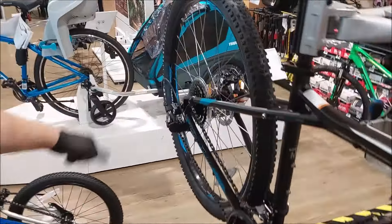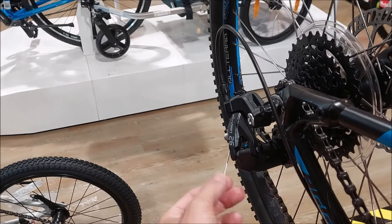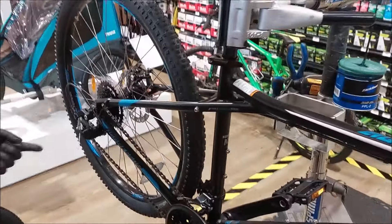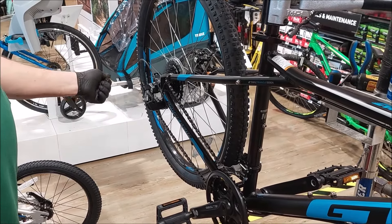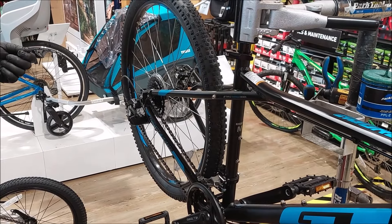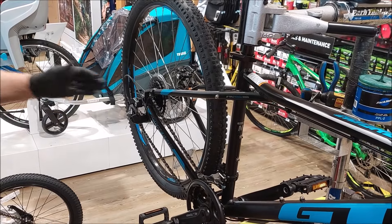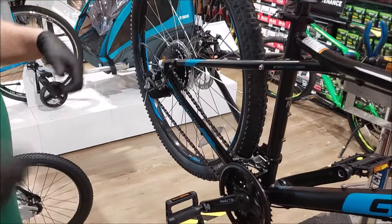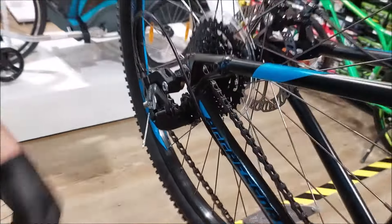Can we go back and look at the actual cable itself? We wouldn't need to mess with unplugging it — just do these micro changes. Correct. 99% of the time during a tune-up I never need to unplug the cable. I unplugged it, got the cable length I needed so it was fully tensioned between the two retention nuts, locked it in place, then made minor adjustments to get the tension to lock into the different derailleur positions.